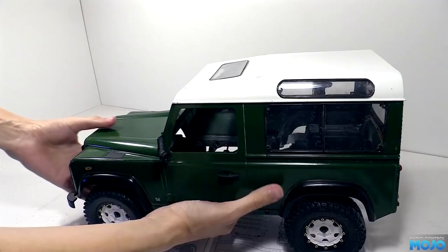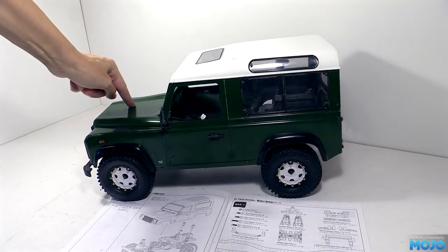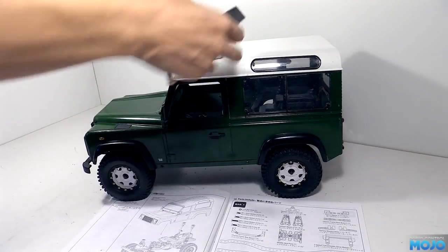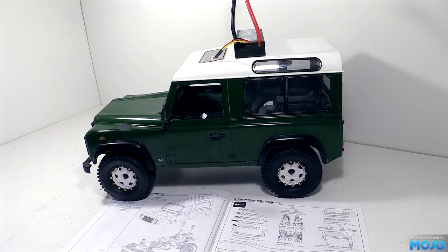The next little problem: you can see that the body's sitting fairly low on the chassis. With the added weight of the battery it only gets worse. If there's any more sag in the suspension the front wheels catch on the body very badly. We could adjust the preload of the dampers to raise it up a bit, but that's going to stiffen the suspension and it won't actually cure the problem — under heavy load the tyres will still rub.